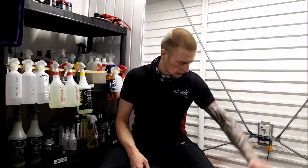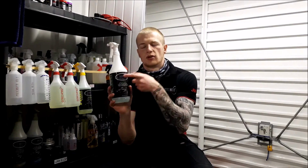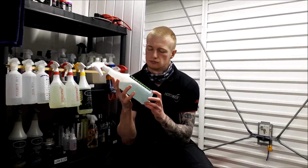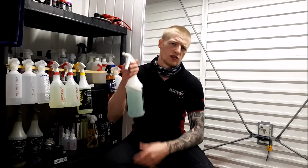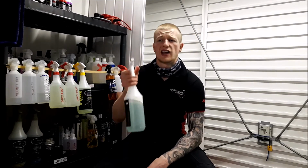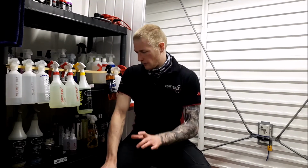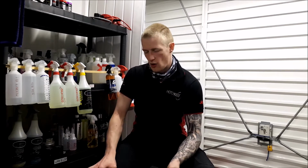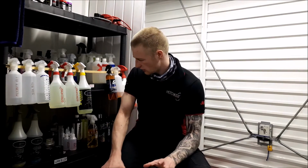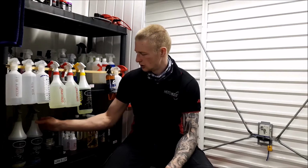Wheel cleaner of your choice. In my case, Crystal Clean Detail or KKD Brakeaway. About 10 to 1, I think I'm using it in this video. Very capable product, or any alkaline wheel cleaner that you prefer. This isn't a necessary step, but I will be covering it in this video. Chemical decontamination on wheels, once you've cleaned it with a regular cleaner.